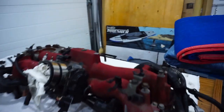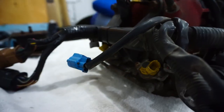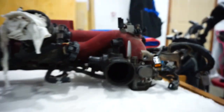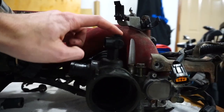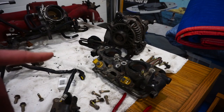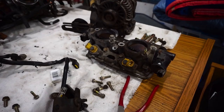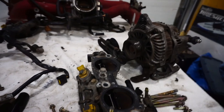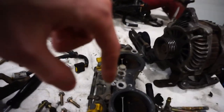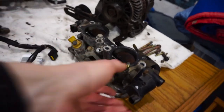If we take a look at the intake itself, these are all going to be gone because that is the TGV delete — I'm always mixing up TVG and TGV. So we don't need as many connectors. This will also be replaced because it's cracked, so we can't use that anymore. The TGV is the thing Subaru put in to disrupt the air at cold starts — it's essentially a little butterfly valve that's kind of restrictive when you start pushing more power.